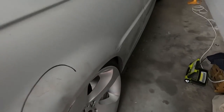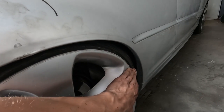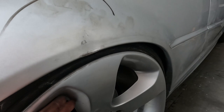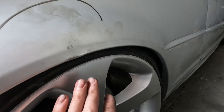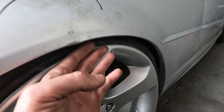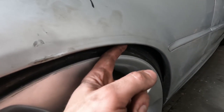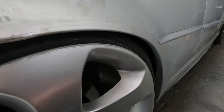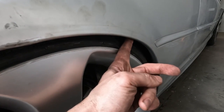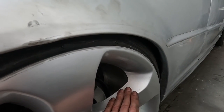Alright, so now these guards are rolled. In a previous clip you would have seen me tuck the wheel right up — as you can see, it scuffs. So the plus 45 is probably ever so slightly too aggressive; I would go plus 44 possibly. Or you can go plus 45 and get a little bit of camber. But on non-rolled, I'd go whatever diameter by 10 plus 44 for a non-rolled guard. I've rolled these and taken another measurement and I've gained another 10 mil of clearance on my roll. So obviously now I can go a by 10 plus 34, and that'll give me a nice bit of clearance in there.